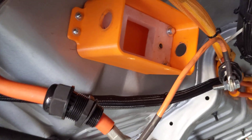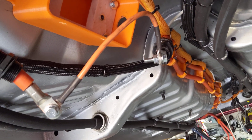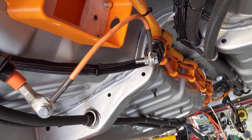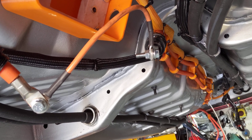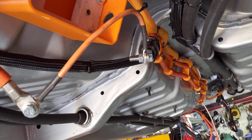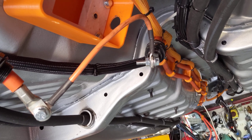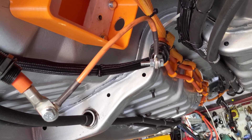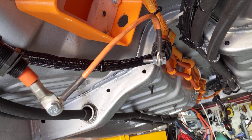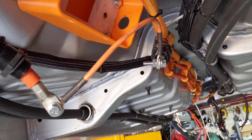This is where the pyrofuse is located in the box that I printed. These are the main connections. What I did is I tried a little test lead right across where the fuse was — the test lead did not get hot whatsoever. So I put a little 8 gauge jump wire and tested the high voltage system. Everything worked: air conditioning, DC-DC charging, the Tesla drive unit powered up and showed full voltage — everything was normal. Until I put the drive unit into forward or reverse. As soon as I selected forward or reverse, I got an overcurrent fault.